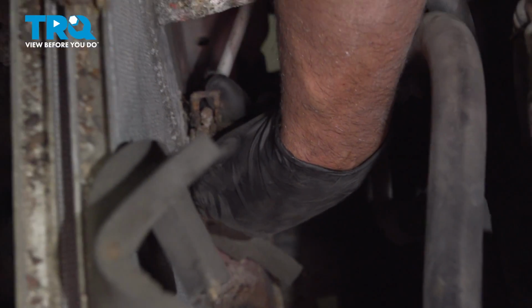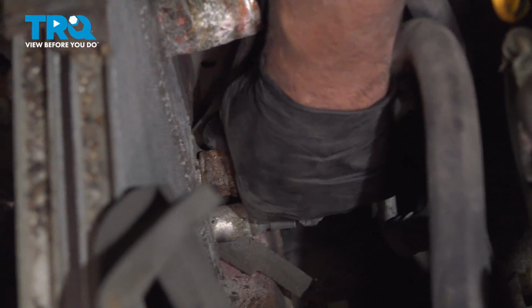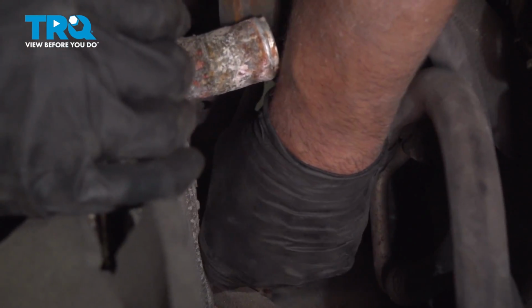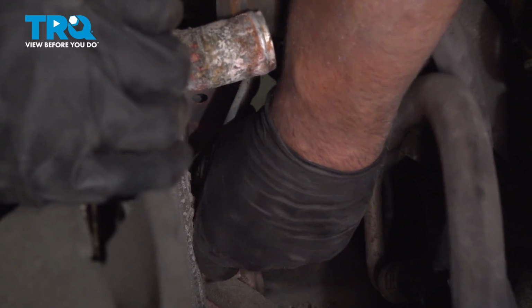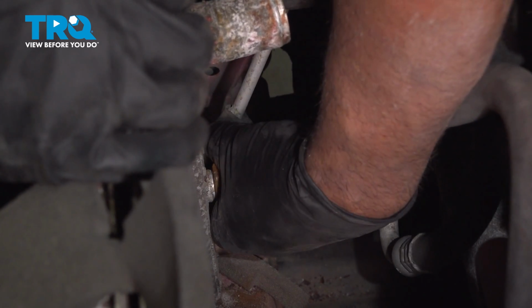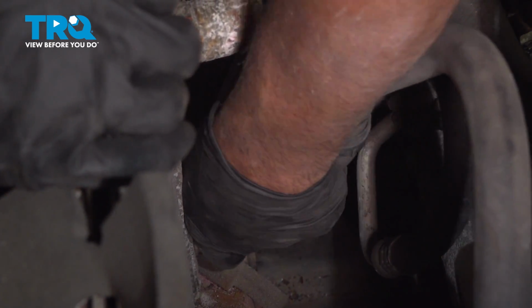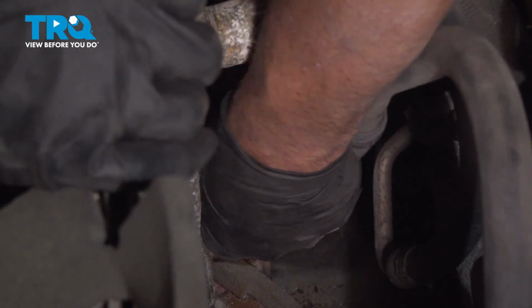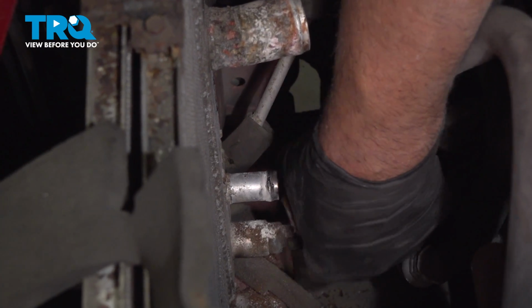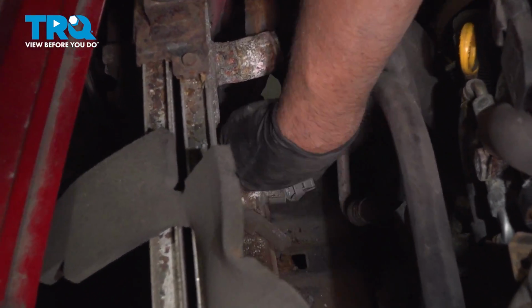This hose clamp is kind of ruined. Use some hose clamp pliers. Take that hose off. That hose clamp moved. You want to put a bucket underneath because you're going to lose some coolant with this. This is in the other coolant system, in the hybrid coolant system. Slide that off. Our system's already drained, but you will lose some coolant there.